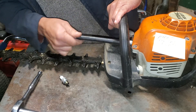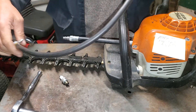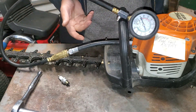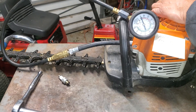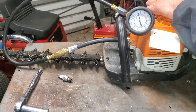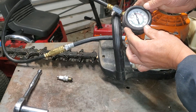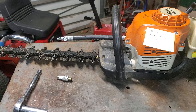Nice and gentle — hopefully I've got the right one. Yeah, it goes in there. Now I know this machine runs great, so if somebody brought this to me and I did a compression test and it showed less than 100 PSI, would I say it's no good? I'm pulling this a few times and I'm getting nothing — I mean it's building a little bit of pressure, but not much. It's not even getting up to 30 PSI, not even up to 10. There's a little pressure in there, but is that bad? What am I doing wrong?